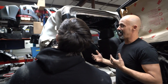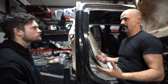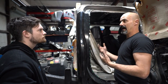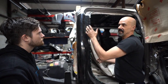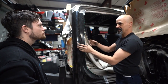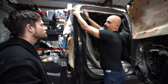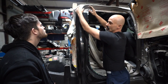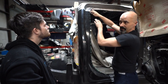If I wind up, because it happens to every technician, I don't care how good you are or how long you've been doing it, the same thing that happens to the young guy doing it as a hobby happens to technicians, even myself. We'll get in a position where the panel we're welding on gets hung up on something, because a lot of times when you're fitting the panel you're overlapping it, which means this panel won't fit perfect. Well, you make your cut, and next thing you know, you're a little wide somewhere.